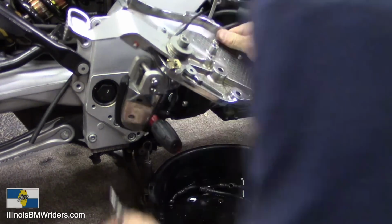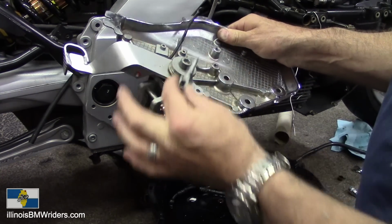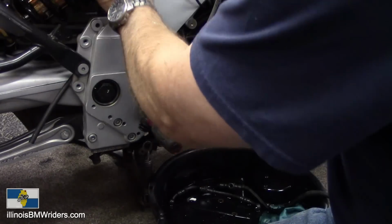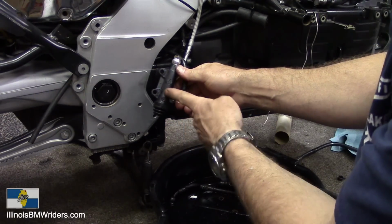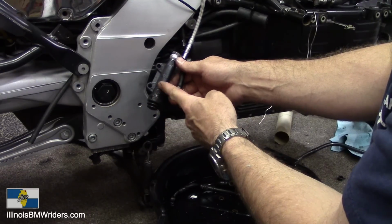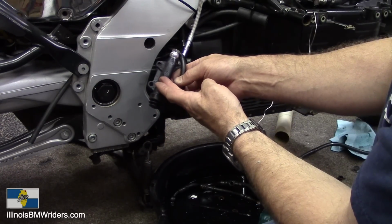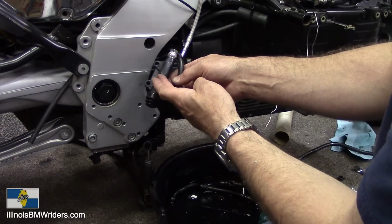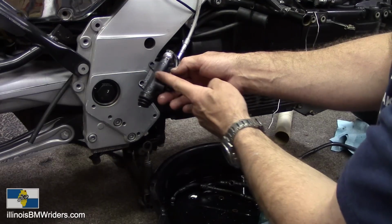So you can adjust it here, and then down here, you want to adjust it when you use this piece here. You want to adjust this so that you're getting the full amount of travel inside of the master cylinder. Because I've seen this before on bikes, if you don't get your master cylinder adjusted correctly, guys would just go and crank that thing down, so that the piston inside here keeps moving up and up. You can compensate at the caliper by just releasing some of the pressure out. But what happens is it gets up past this fill part right here, and basically your brakes never refill.